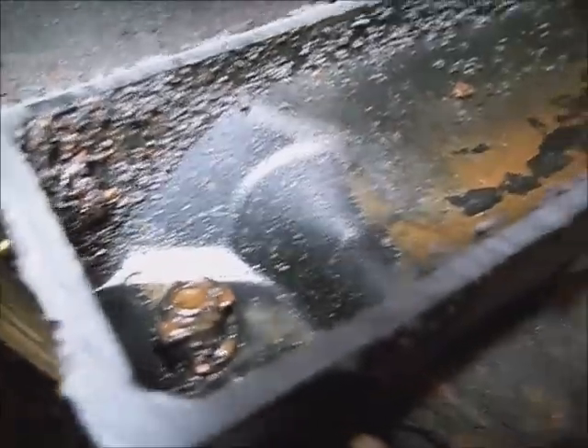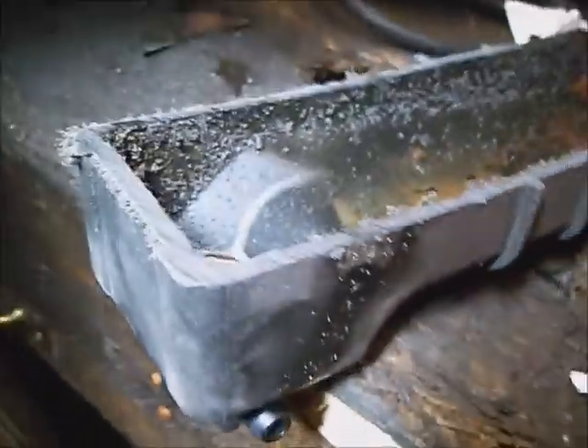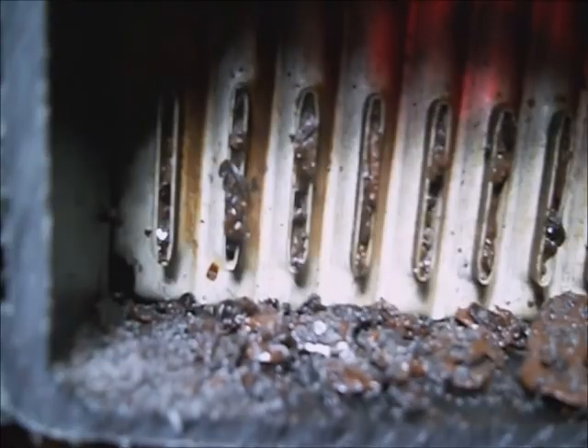I took a metal cutting band saw and cut the tank off on the inlet side, the flow in on the radiator, and that's why the bottom wasn't distributing any heat and barely the top.